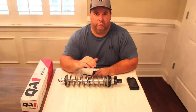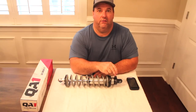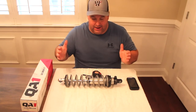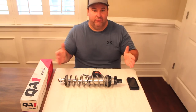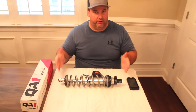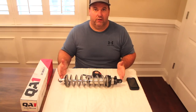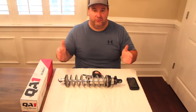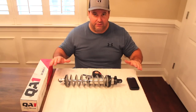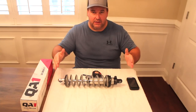It's very important to understand: before you mess with the compression or rebound knobs, before you turn the first dial, the shock has to be set up correctly in the car — at ride height, at race weight. Do not even start messing with compression or rebound until you get that right. QA1 are great guys — you can call them up and they will help you get your shock set to that right spot. These DD501s, we're going to set them at 14 inches, adjust ride height with the spring, and then go test. But first, that shock has to have the right amount of sweet spot to extend and compress.